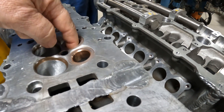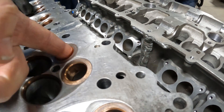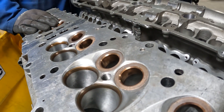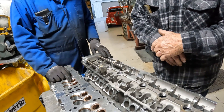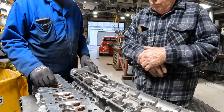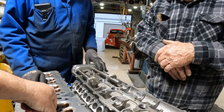If you look at the seat, we actually make a little venturi out of the exhaust seat to try to get the velocity going out the exhaust a little better. The seat is very deep — it's made into a venturi. We ordered the seats from CET. The seats are really deep: 700 thousandths long, with a tail to the venturi on the back side, and then we do a radius top or under-seat cut.